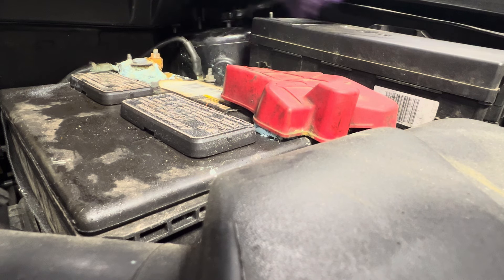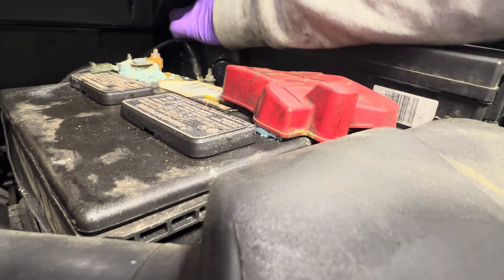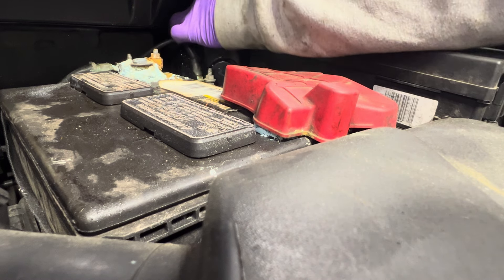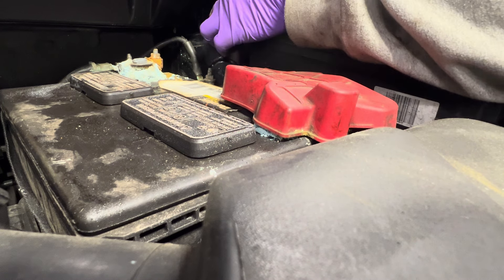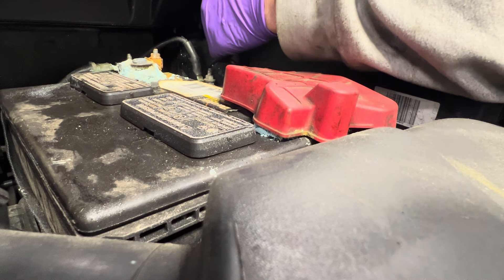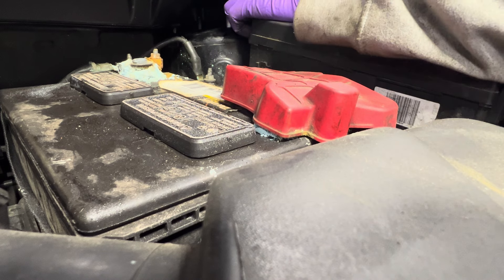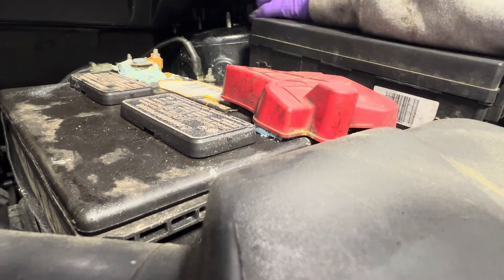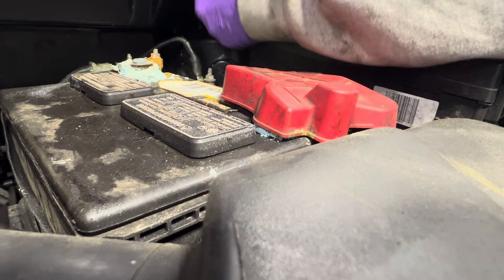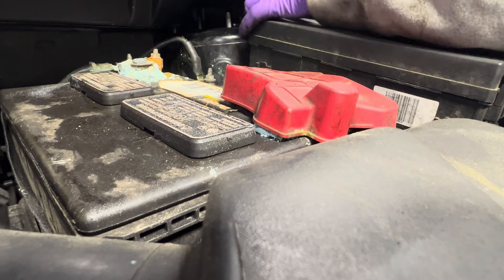If you're just tuning in or you skipped ahead trying to figure out what I'm doing — I am not taking the cowl panel out in order to take out the struts. It's a couple more minutes of work this way, but I think it's probably a lot fewer minutes overall. I'm not worried if this one gets jammed up — it's in ratchet mode. If for some reason I get stuck and can't get the ratchet wrench out, I'll just take the front one out with a different wrench and when it drops out, I'll be able to get it.